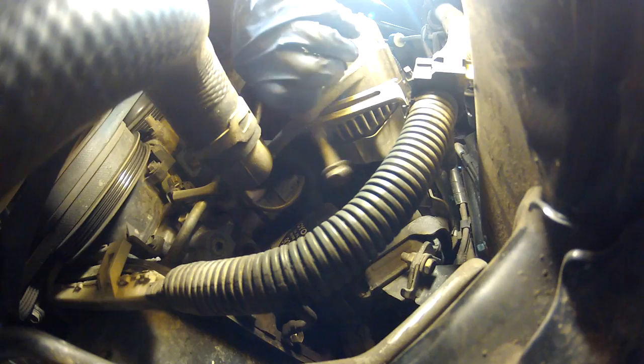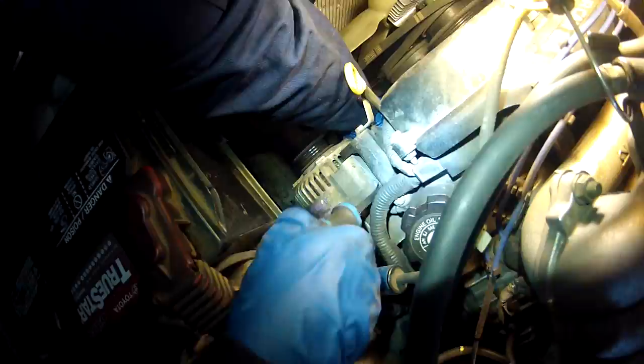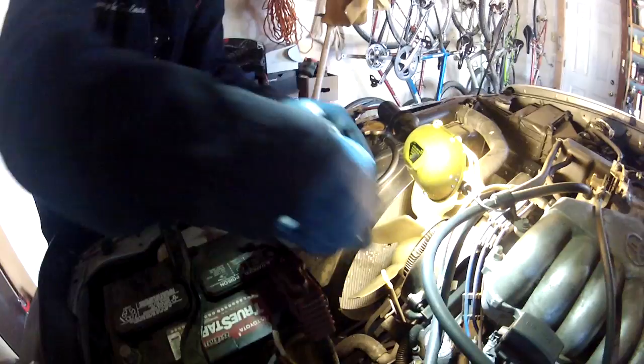Now I've got to take the lock nut off, and then remove the pivot bolt so I can take the alternator out. The alternator appears to be kind of wedged in the bracket, so I'm using this little pry bar to break it free. A little extra force — there we go. I can get at this connection now, got the connector off, and the alternator's out.